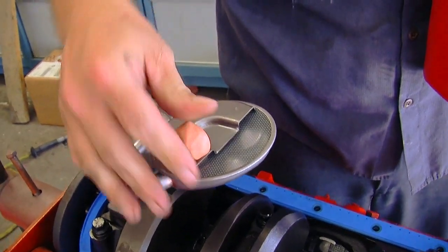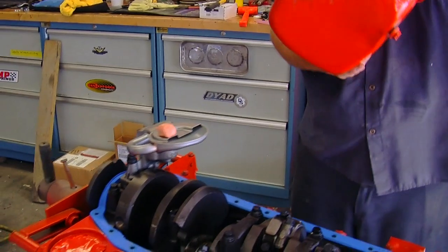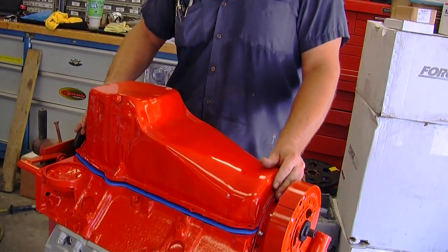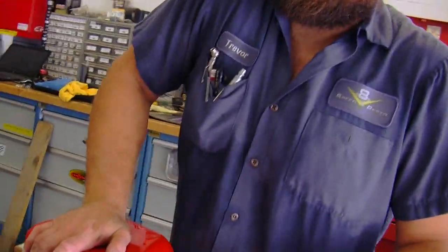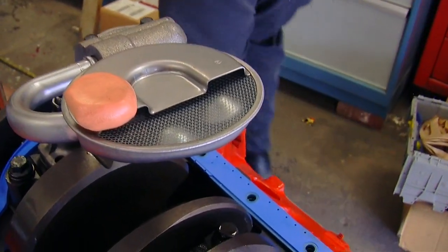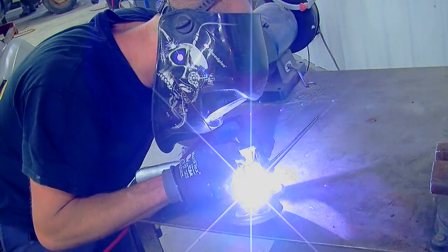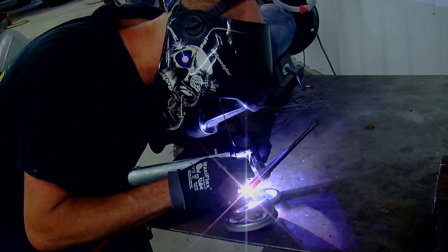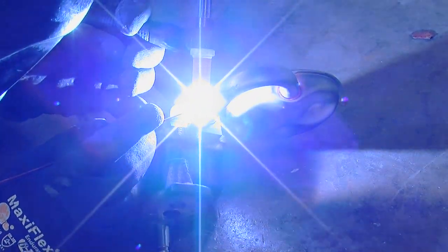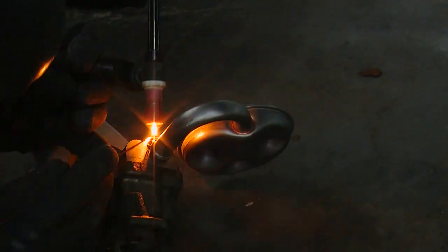That way you have a compressible medium you can measure to see where you're at. Most engines have a spec — in a lot of cases around three-eighths to half an inch is usually pretty good. If you're running an aftermarket pan they'll often have a spec provided. If you don't have a spec, most of the time the pickup should be basically parallel with the pan, so take a visual cue of where you should be. Once you've determined your pickup is where it should be, press it the rest of the way in. It's always a good idea on a small block Chevy to weld the pickup to the pump so it can't twist or come loose, causing oil problems. So I had Adam put a couple of tack welds on to make sure it never comes out.